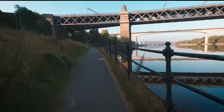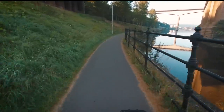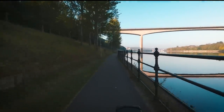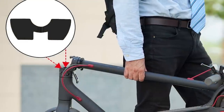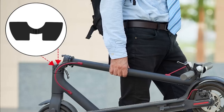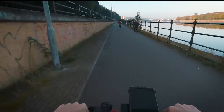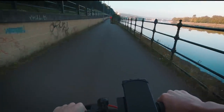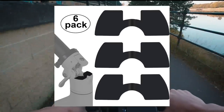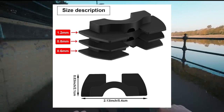Before this arrived, I thought my Xiaomi scooter was broken or about to break — because as probably any Xiaomi owner will know, after a few weeks of usage the stem develops a very annoying rattling sound. I found out this rattling is very normal. After repeated usage of the folding mechanism, the seat of the joint wears slightly with repeated folding, which ends up with the handlebars feeling a tad loose and a distinct rattle noise. This can be remedied quite simply by purchasing a rubberised plastic spacer and just sliding it into the hinge. Packs can be purchased for around five quid, and trust me, if you get the rattles this will be your fix. Installation is a simple matter of selecting the correct thickness — many packs come with three different thicknesses.